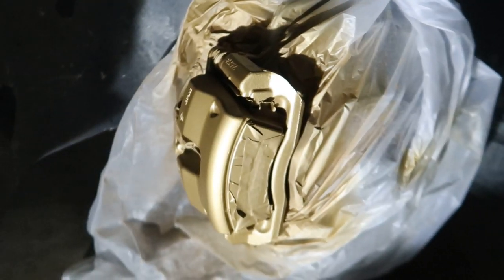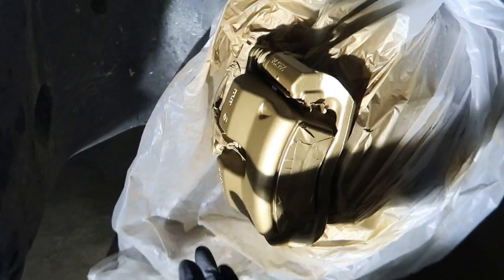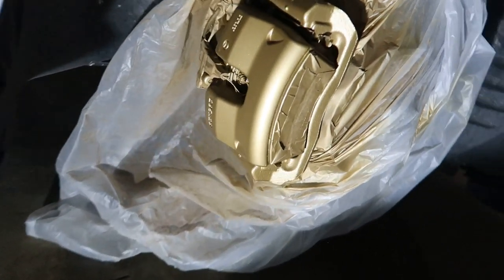That bug's neck. So I have my third coat. I'm about to do my fourth coat, and I'm letting it dry every 10 minutes in between coats. So your first two coats should be really light, and your third, fourth, and fifth should be medium to heavy, so you have an even coat all the way around. That's how I'm doing it. As you guys can see, this is my third coat, and it looks pretty evenly laid out. All the edges, the corners, the angles. So I think that looks good.